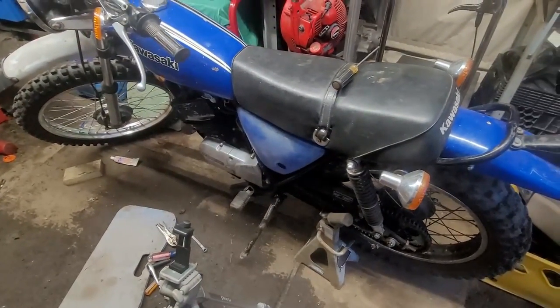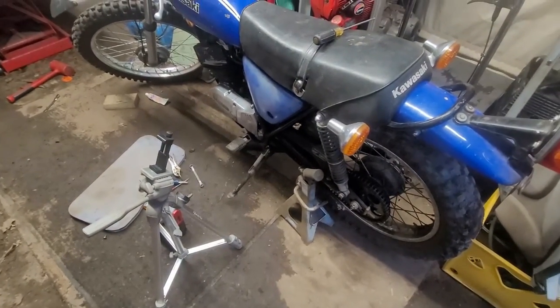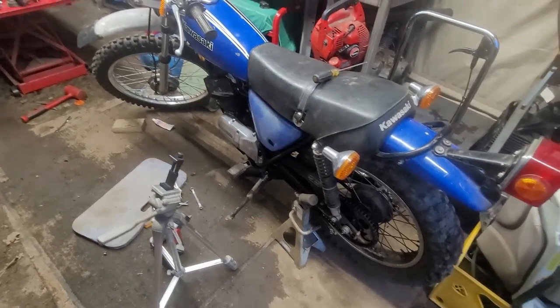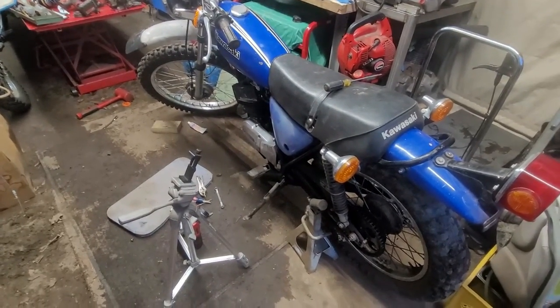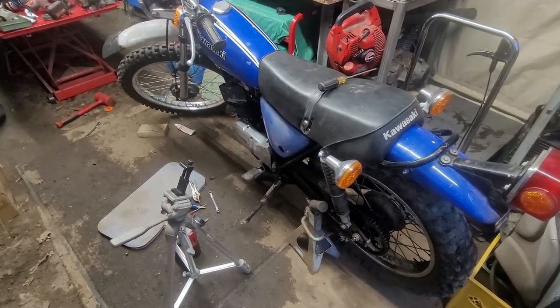This bike guys — it is in pristine condition for its age and year. I'm using an automotive jack stand because the kickstand all the way down puts the bike at too much of an angle even for the video. I stick the jack stand underneath the peg in the back — it holds it up great. That's also good for storing the bike: it takes the weight off the tire and allows the suspension to settle. You can also use two jack stands to get the whole bike straight up off the ground, which makes it easy to change the back tire too.